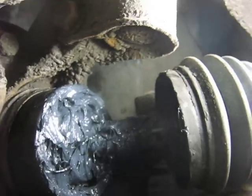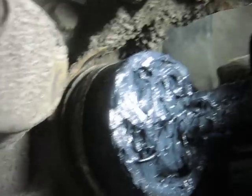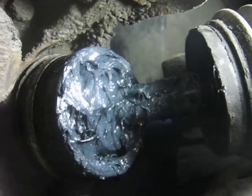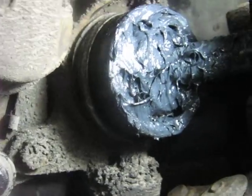Anyway, I'm about ready to try to put this back together here. I've got to figure out something for a new CV joint clamp. I have the special pliers to re-crimp it, but I'm not convinced it's going to hold. I may end up giving that a try anyway, because there doesn't seem to be enough room in here to try my favorite hose clamp trick.